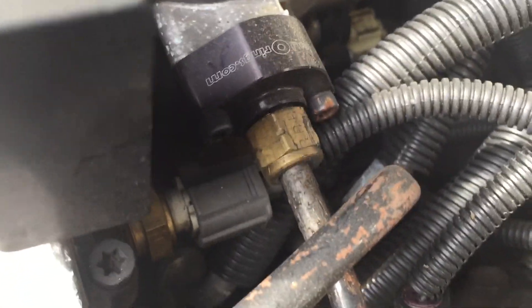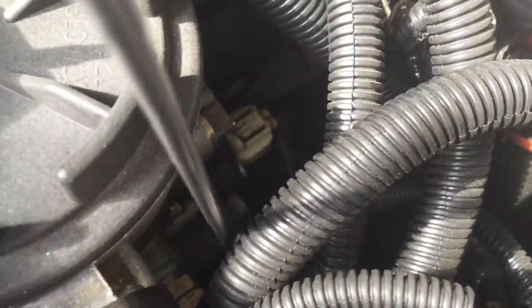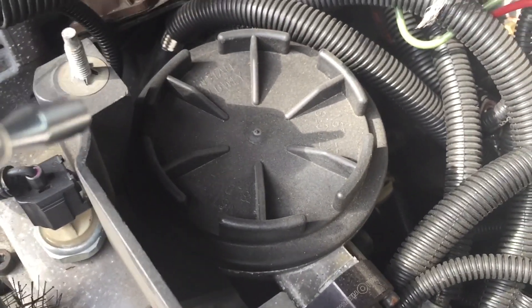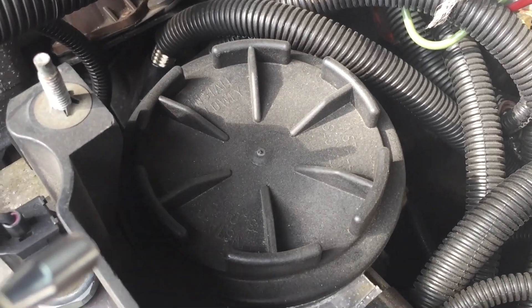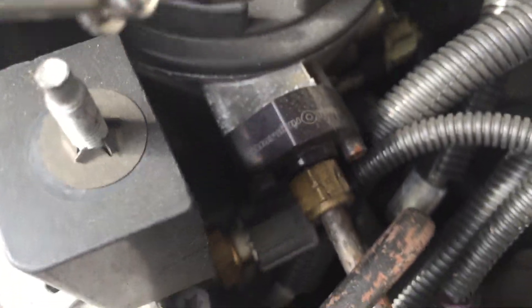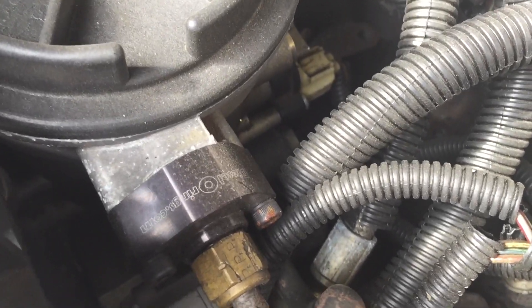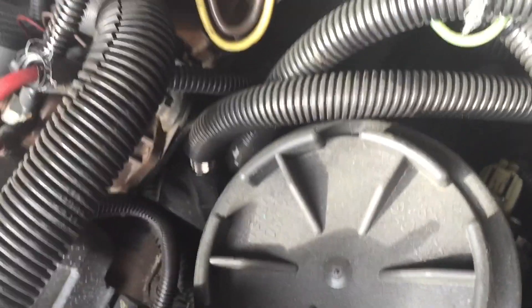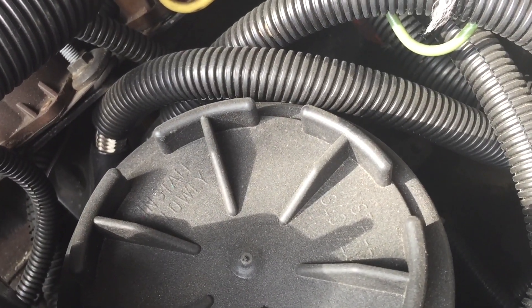If the FPR was out of the way, you'd see some of it. The IPR is on this side over here, but that's why you've got to take this fuel bowl out in order to get at the HPOP to replace it. You can potentially do the lines without pulling the fuel bowl off, but it's going to be tough, as you can see. I've also already replaced my fuel lines with quarter inch, three-eighths inch braided line, so it's even tougher.